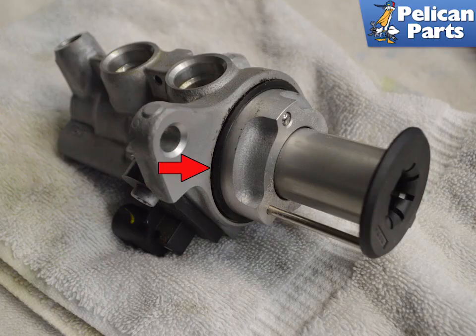If you are reinstalling the master, make sure to replace the reservoir sealing o-ring on the rear of the master to the brake booster. Installation is the reverse of removal. You're going to have to completely bleed your brake system, including activating the ABS pump with your scan tool. Do not try and drive the vehicle without completely bleeding your system with your scan tool first.